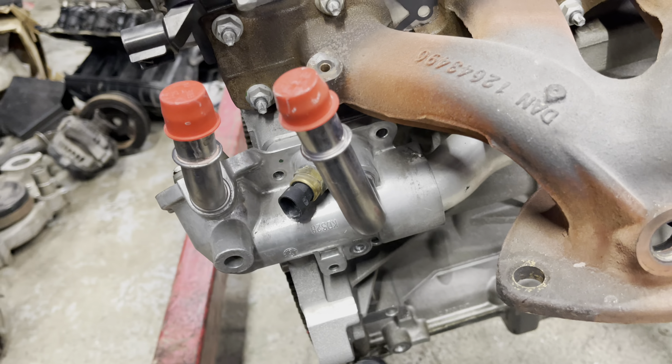All right, we got all three of them. Now that the 10 mils are out, take a flathead and pry back here — that takes off the whole water pump. You can see where those three 10 millimeters went through. There is an O-ring here that the new water pump does come with. The water pump didn't come with the front side housing — some of them do include a gasket — so remove the couple of 10 millimeters in the top cover. Now you can see where the water pump actually holds that gear in place and it's part of the timing.